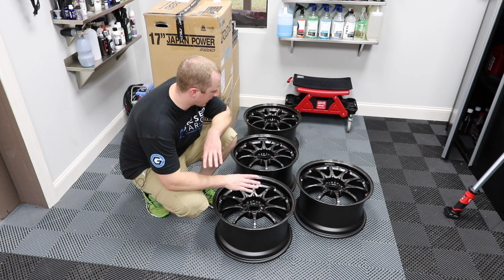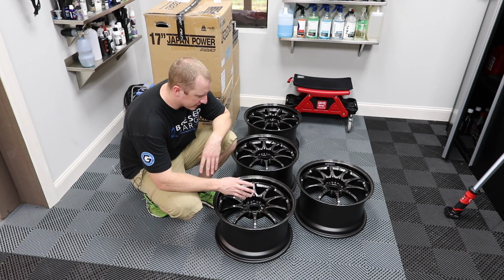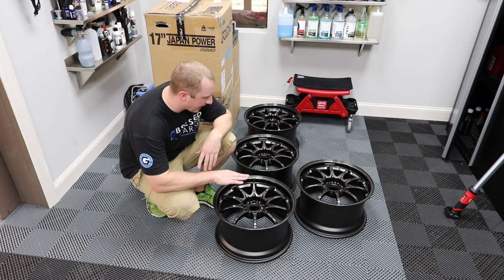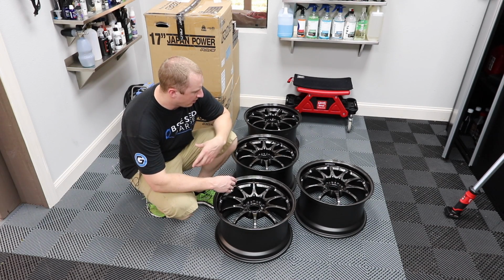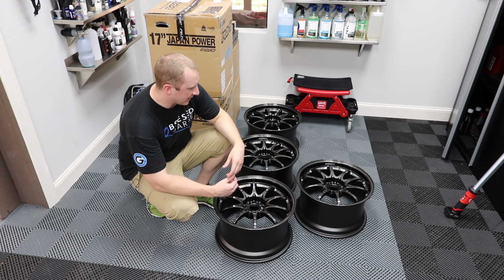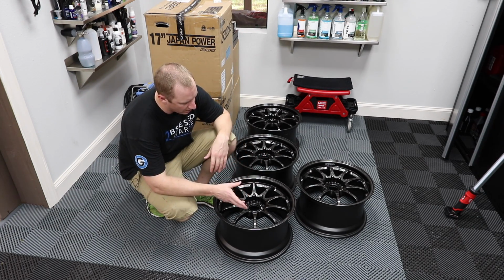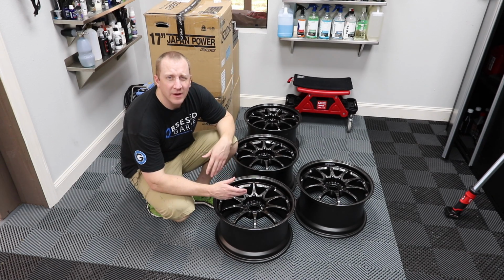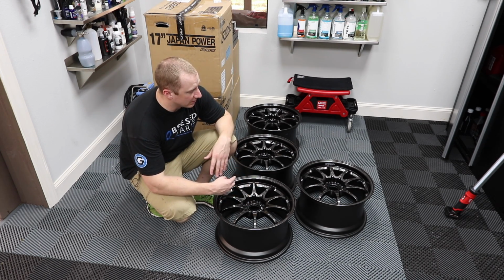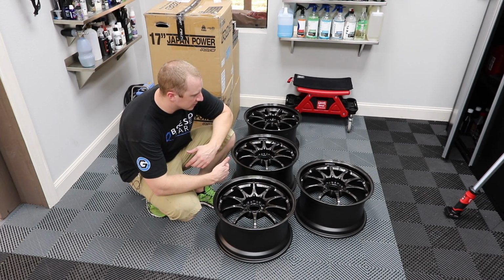All right, so what I decided to do, I went and watched a couple of videos, was thinking about it a little bit. I'm going to do a second coat in a couple of hours of stance, and I'm going to lay it on pretty thick, and then I'm going to let it sit for 15 minutes and then wipe it off. And the reason for that is, stance is higher temp rated, and so if I put Miyabi on top of this, it probably won't last very long. So I'm going to do the stance second coat, then I'm going to follow with overcoat a couple hours after that. That's my plan. I'm also going to get out the calipers for the Stop Tech Trophy, so I'm going to get those out here in a minute and do those as well. And then we'll be done with the project.